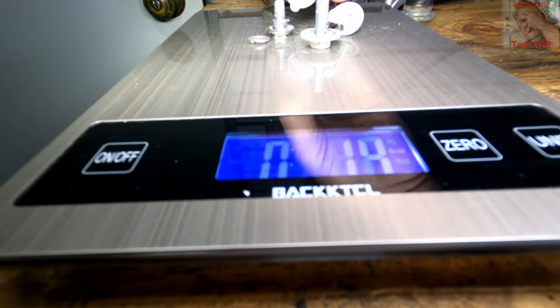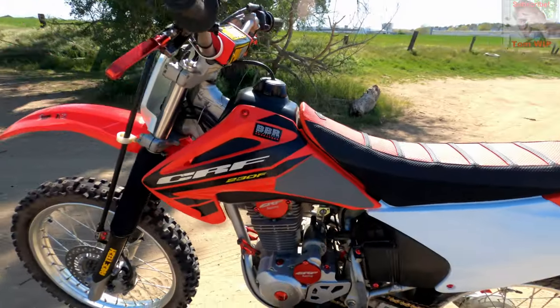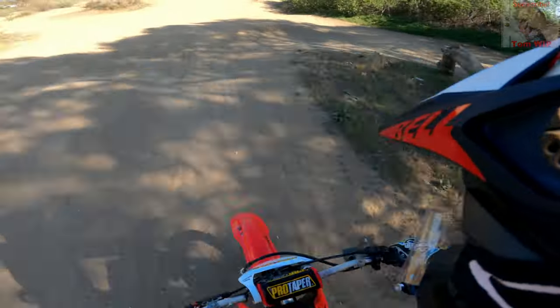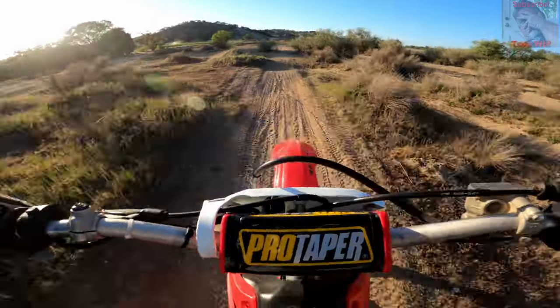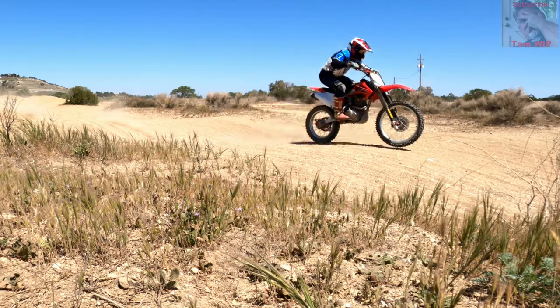I suppose you want me to cut to the chase and tell you how much weight was cut altogether. But first, I want to talk about the difference it made on the bike. The closest test spot I could find is about a 15-minute drive from my house — just a bunch of sand with some sand whoops to check out the fork action and do some quick testing. Not going to be any epic track day, but it's the only thing close by. I took it out, and with the new springs front and rear and the Racetech gold valve emulators in the forks, they worked beautifully. The forks were no longer harsh, no longer bottomed out — they soaked up the bumps like butter.